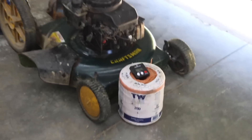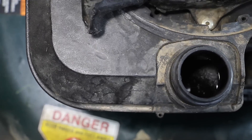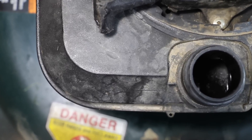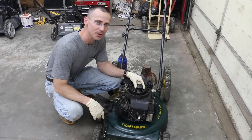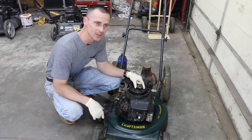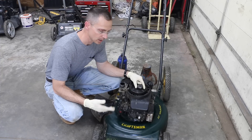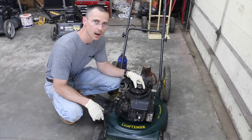It's been about 105 minutes since the engine started, so let's take a look inside the fuel tank. As you can see, the fuel tank is empty but there is sugar inside the fuel tank. It doesn't appear that sugar is going to cause any significant damage to this engine, but we still need to make sure that the compression hasn't changed and the inside of the engine looks fine. I'm going to do a quick compression test both hot and cold, and then we'll take the cylinder head off and see what it looks like on the inside.